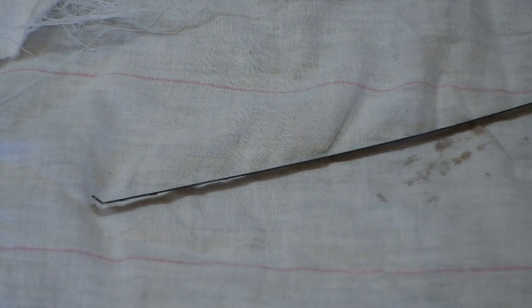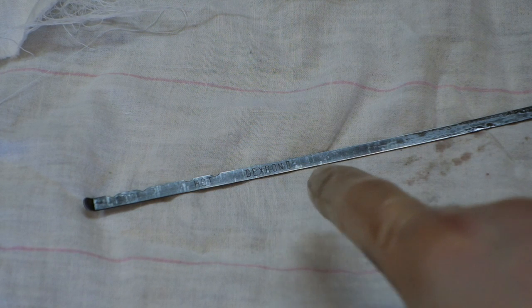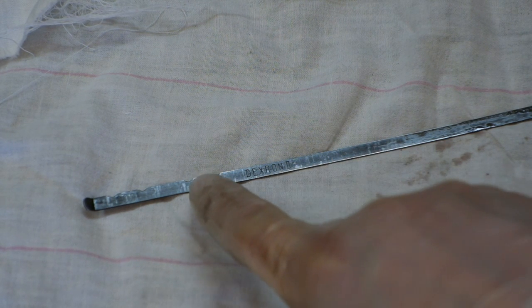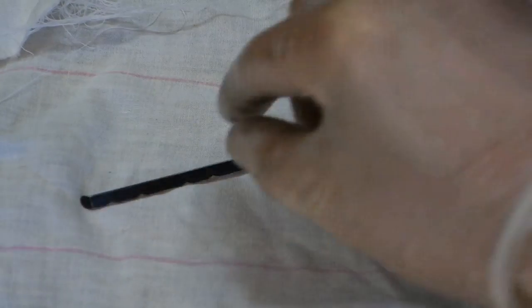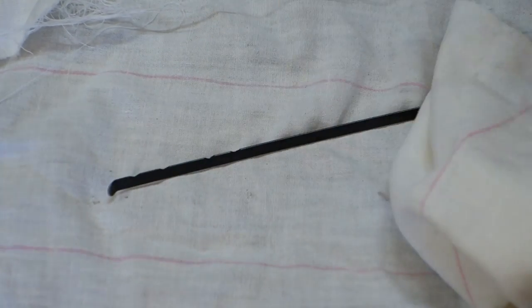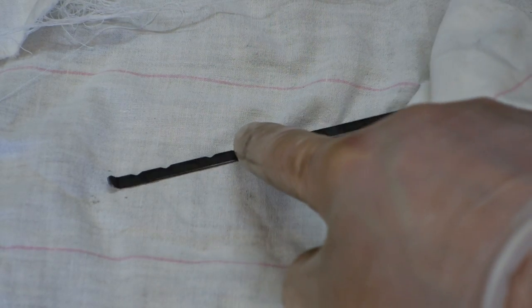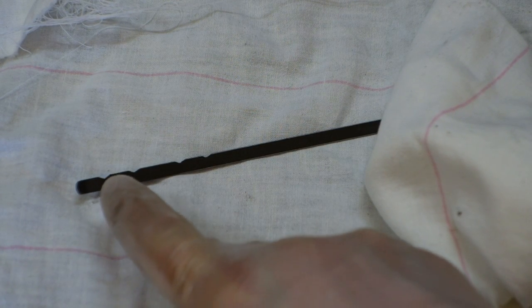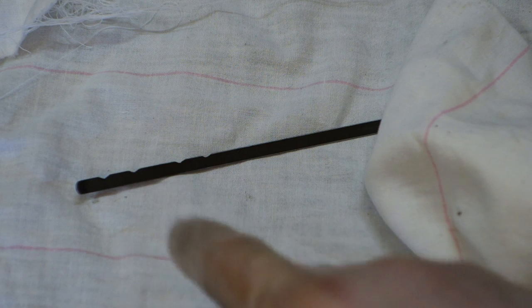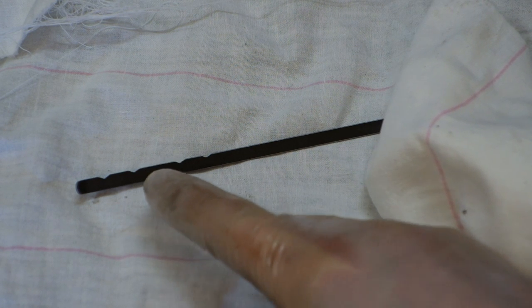And there is text in here, Dexron 3 or 2, sorry, this is the minimum oil quality in here. And then we can see there are hot and cool points. Then I clean that a little bit. And that means that we can see those small hills, or actually those dents in here. The first low dent is the minimum level for cool oil, and the upper area is the maximum level where we must have the oil level when this transmission is cool and cold.